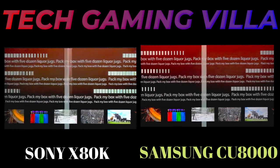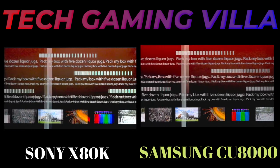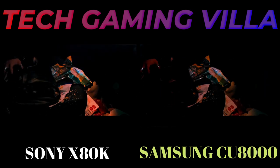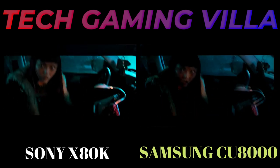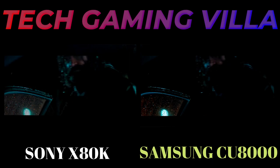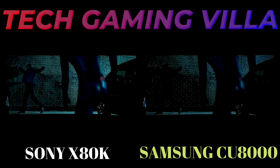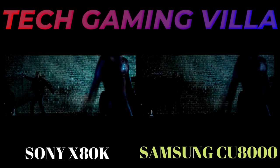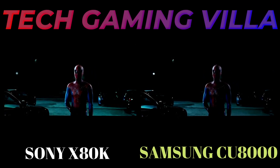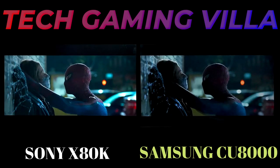Comparing the two, the Samsung CU8000 is better overall than the Sony X80K in several areas. The Sony X80K uses an IPS panel which gives it a wider viewing angle than the CU8000. The CU8000 has a VA panel, so it has far better contrast and better black uniformity. The CU8000 also has far superior low-quality content smoothing and can remove 24p judder from native apps. However, the X80K has a traditional RGB sub-pixel layout, so it displays clearer text when used as a PC monitor than the CU8000.